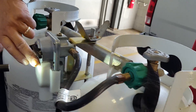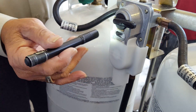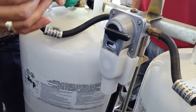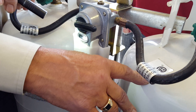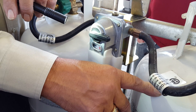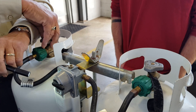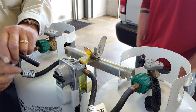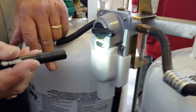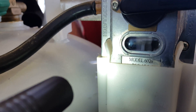This glass right on the back here is your sight glass. This is a selector switch pointing to this tank. That glass being clear is telling you this tank has gas — not that it's full, just that it has gas. Both tanks are full right now. The way this is set up, you'd use this tank first. When it gets empty, it automatically switches to the other tank as long as both valves are on. When it switches, this little glass here is going to turn red.